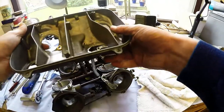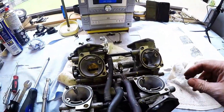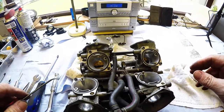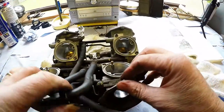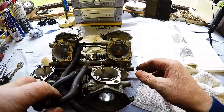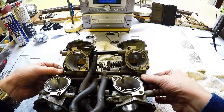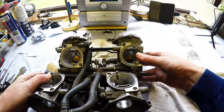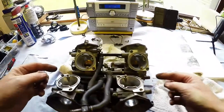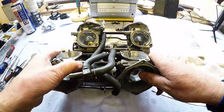There you go. They call this the air intake chamber. Let's get it all back around the proper way again. There you are, front end. He also says remove the O-rings, which we shall do with the little picker tool. It would appear by the removal of these two screws, air intake off, the whole thing's become fairly slack.